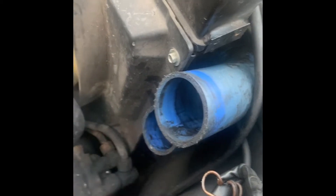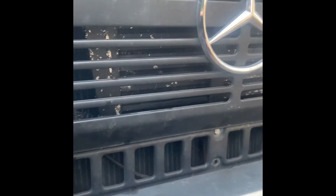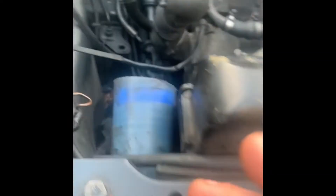For intercooler hoses, you're going to have to route your intercooler somewhere. Mine is just here — you can just about see it behind the radiator. I've seen people mount it underneath, which keeps the radiator cooler. You just need to find space for it — luckily there's plenty of space under here. Some setups route both pipes up and around on the same side, while others go out and around the other side, so you'll have to consider that.